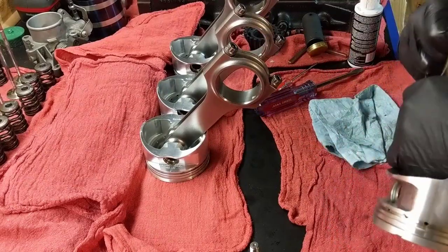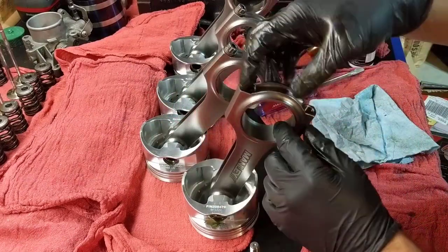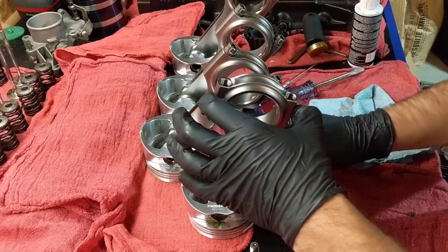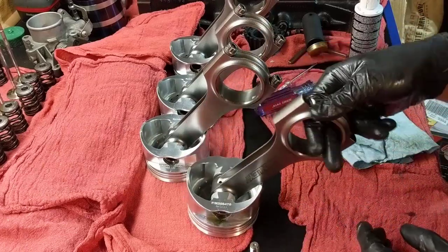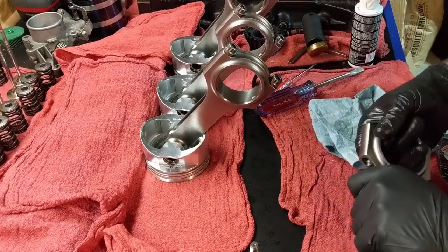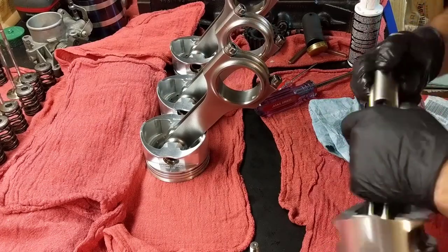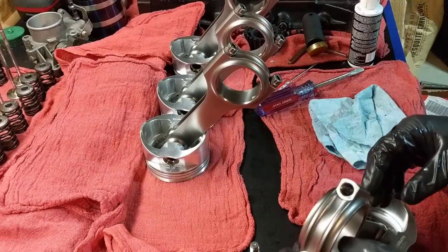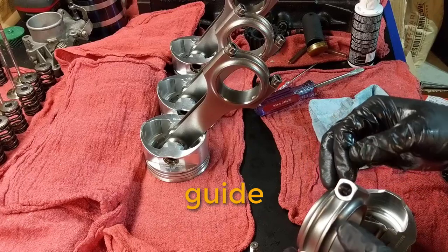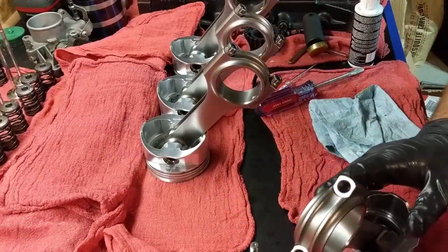they tap it, because what happens is you can't mix them, because they have one piece and they cut it. So this matches only this connecting rod and not that one. Right, it might be very similar. Sometimes it might fit 100% perfect, but this is 100% perfect always. So let's get a... There's inside here, there's a little metal piece that goes in there and fit this 100%. So we need to tap here, here, here, and then this will come out.